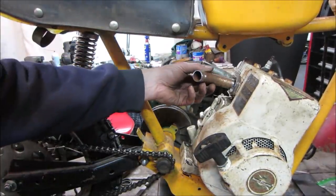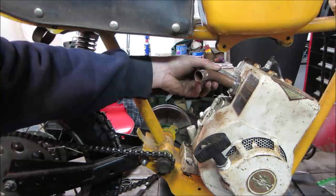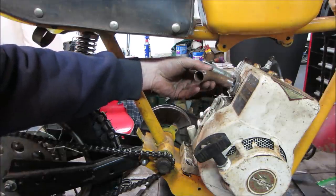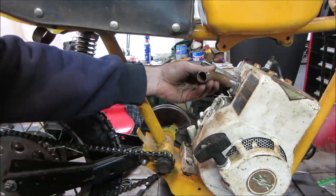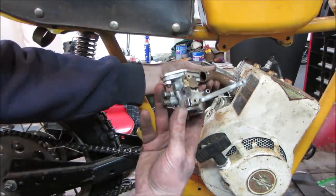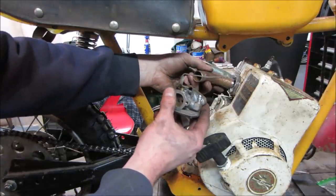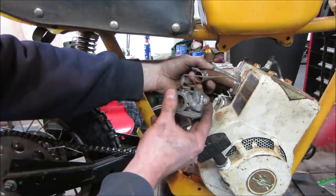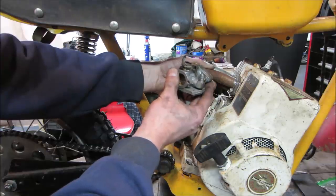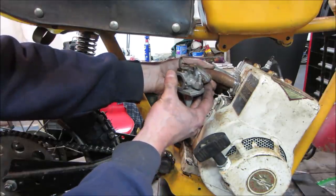All right. So if we went, I would say, that's almost true. Can we flip it around? Will it do anything for us? It looks like it gets us away from the exhaust a little further. I think that's going to get in the way of the pull start though, right? By the time it's got an air cleaner on it. And yeah, it's getting kind of far away. You can shorten her up quite a bit too. You don't want to go too long on the intake. It changes your torque curve and your horsepower.